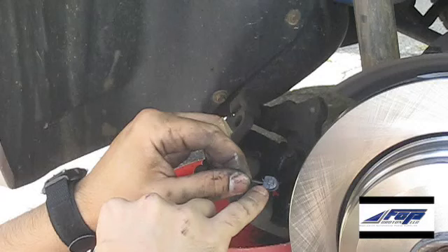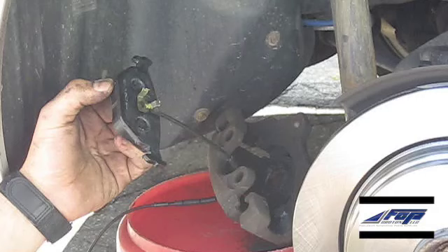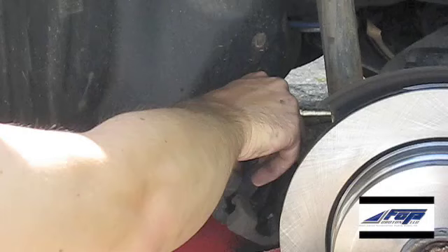Next, thread the sensor wire through the top of the caliper with the little raised groove facing the inside of the pad, and just go ahead and clip that into place. I also went ahead and put a little anti-squeak lubrication on the back of the pad — just going to feed the pad through and lock it into place on the piston.